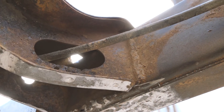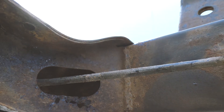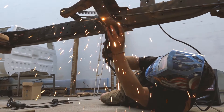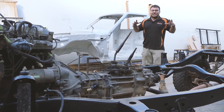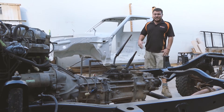One of the only problems we found on this chassis was around the midsection on the driver's side — there was a bit of corrosion on one of the cross members. So I've cut a steel plate and welded it in place. Welding's all done, painted the chassis. We're at the stage now where we're going to get the cab back on the chassis, but first we're going to spruce up the engine and gearbox so they look good when they come together.